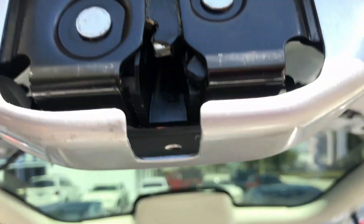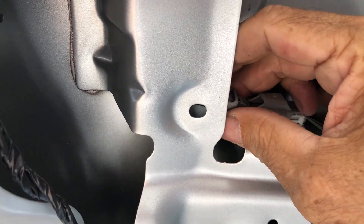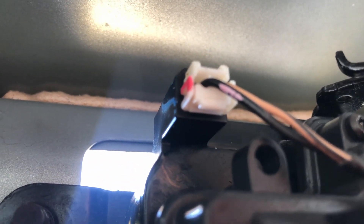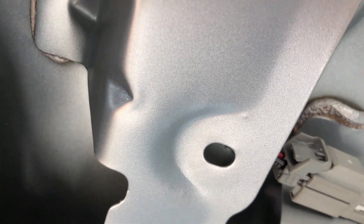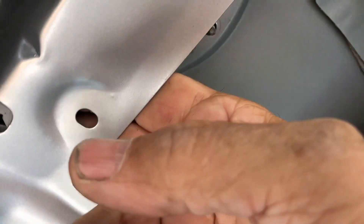There's a touchpad under here. Disconnect the touchpad and then connect it back — did you hear that? That's the actuator setting itself. Let me do it again so you can hear the actual sound. One, two, three. Okay, so the actuator is working; the touchpad isn't. So we're going to take off this touchpad.